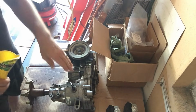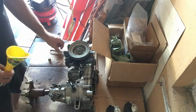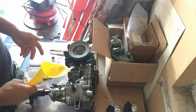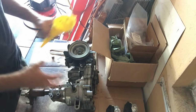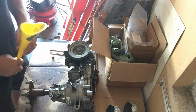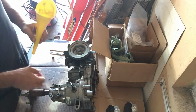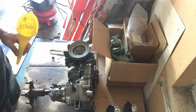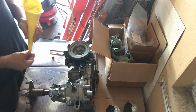Okay, so it's been 24 hours since I put the gasket on. That's the minimum wait time. As much as I'd like to wait 12 more hours just to be sure, it feels like Christmas morning, and I want to open my present and make sure that it works. So a couple ways you can do this. The Hydrogear website says to put the transmission fluid in, again, 20W50 motor oil, and then install the transaxle, which is exactly what I'm going to do.